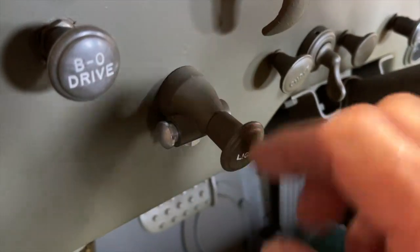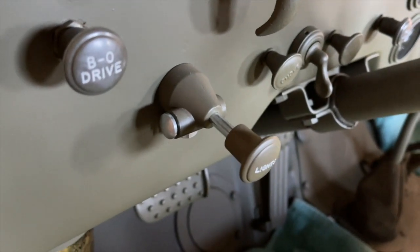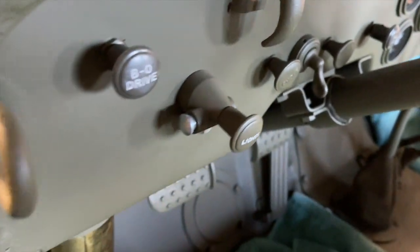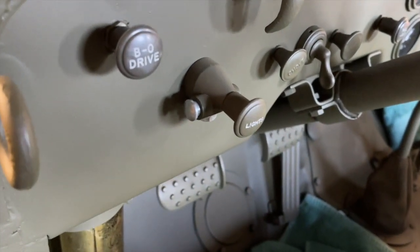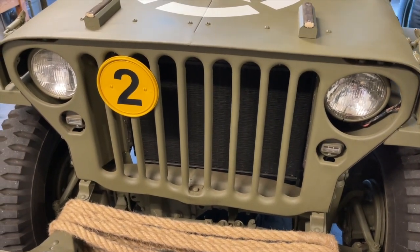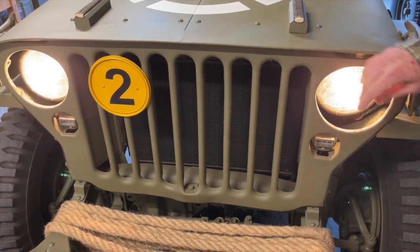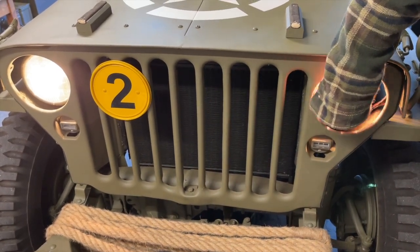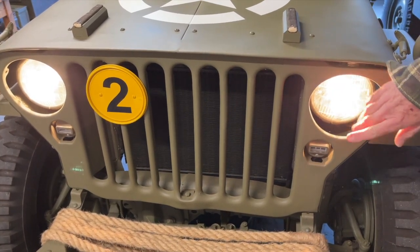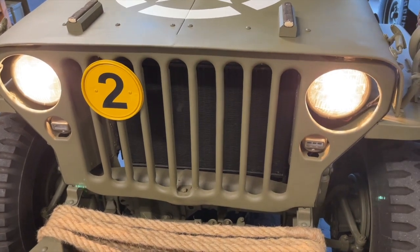All right, if we did this okay, all we've got to do now is pull our switch. That's the first position for blackout — we'll be doing a video on that in the future — then push that little tab in to get to the second position. If we did this correctly, we'll walk out to the front side of the Jeep and we should have some lights on our headlights. Here's the great test — let's go ahead and pull that switch, and the magic should happen. The last thing I'll have to do, not in the very near future, is adjust those headlight beams per the manual specs, and we'll do that in the future. So we're all set — we've got some headlights!